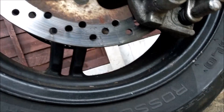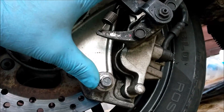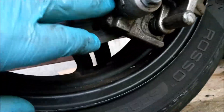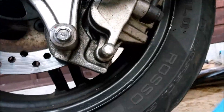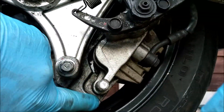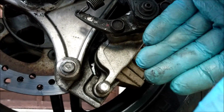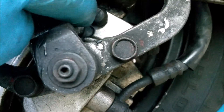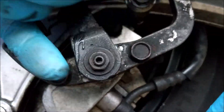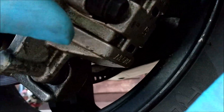It's not good at all. To get this off, basically you do the two bolts - one there, one there, 12mm - you whiz them off and this carrier drops out completely, just clears the wheel. So it's all sort of hanging out here nicely. You have two slidy pins - the caliper slides in and out of the cradle as you apply the brake, it slides a tiny bit, you apply the brake, let go and it slides back again. There's a pin there and a pin in there - that's a rubber bush type boot. You've got your two pins on the carrier, and this caliper slides in and out on there.